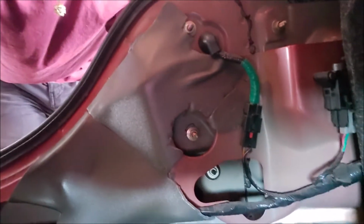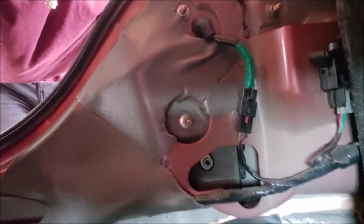So I'm just trucking along here, and as you can see, I'm starting to lay some of it on the side of the trunk. Just 2 things to remember. One, this stuff is very, very sticky, so try to use cardboard or some sort of paper to cut it beforehand. And as well, on this car or other cars, remember that you should leave some of these screws exposed if you need. Like these 2 guys on the new edge are for the tail light, so if you ever need to get to the tail light, you should make sure that they're somewhat visible.